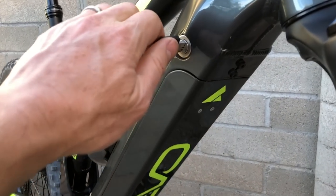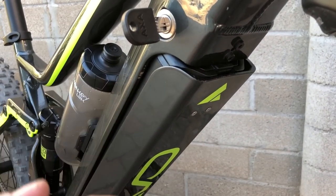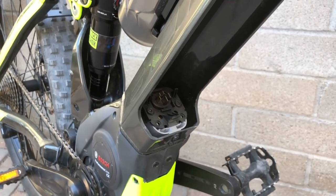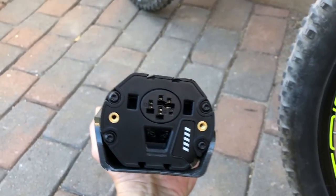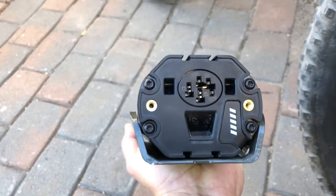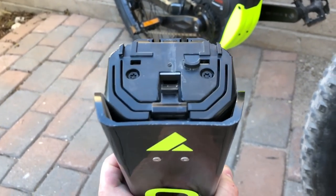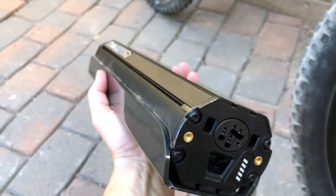Here's a closer look at the battery pack removal. You unlock it with one of the supplied keys — the bike comes with two. There's a safety latch that prevents the battery from fully dropping out, so you push that in with your finger to release the battery fully. It pops out of the down tube, and you can see the typical Bosch connection point and the open down tube. The charge port is on the bottom of the battery, so you plug the charger in there if charging off the bike. It also has a battery level indicator during charging. The aluminum plating surrounding the pack is pretty thick and solid.